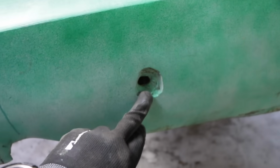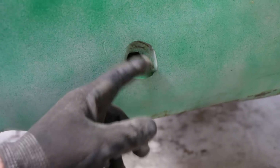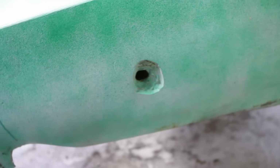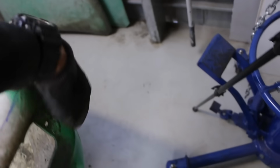And a big telltale is, have a look at that bumper bracket hole. That thickness there, that is all bog. So this whole back end is just solid bog. So I'm going to cut this whole rear panel off. You can see Tim's helped me out and drawn some lines on here. So I'm going to be cutting that off there, and removing the whole rear panel.